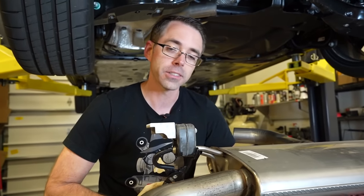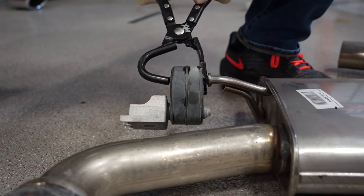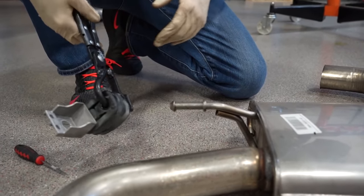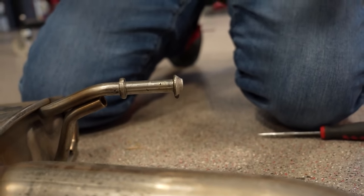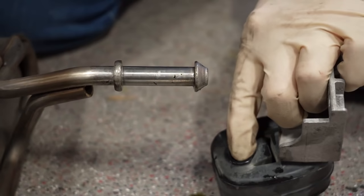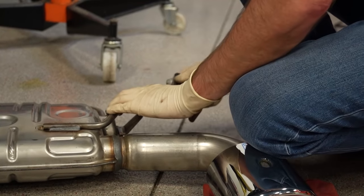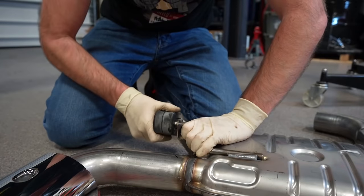We'll link to them in the description below where you can purchase a set just like this. These hangers are wider than they normally are, which is why I'm struggling. The trick is you work it off with a pick — also found on shopdap.com — then you can use your pliers to slide the rest of the way off. As you can see, the tip is significantly larger than the hole, which is why it bites on pretty hard from this barb. Now we're going to go back on with our hangers — getting them on is way easier than getting them off.